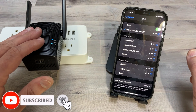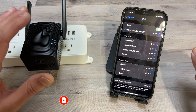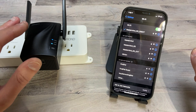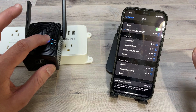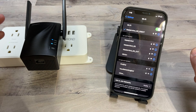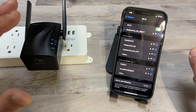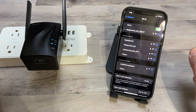Another really nice thing about this repeater is it has a little LED by the signal to let you know if it's in a good area or not. If you're in a good area with a strong signal the LED will be blue. If it's red, you won't want to put the repeater there because the signal is too weak. If there's no LED, there is absolutely no connection. So you want to move this into an area where you see the little blue LED.